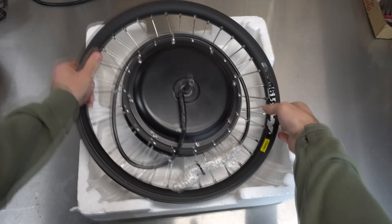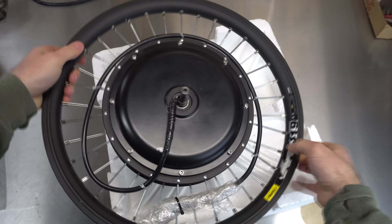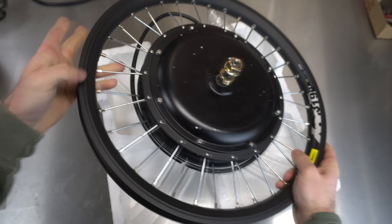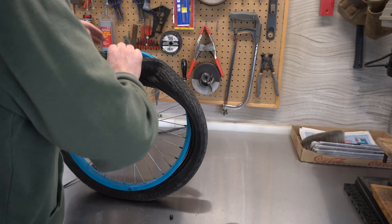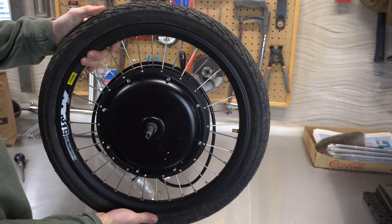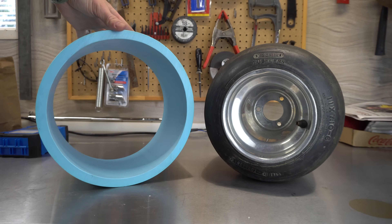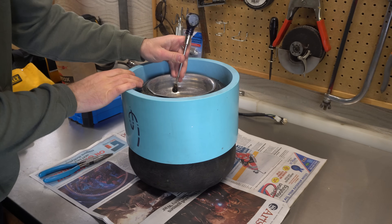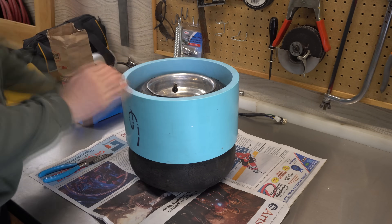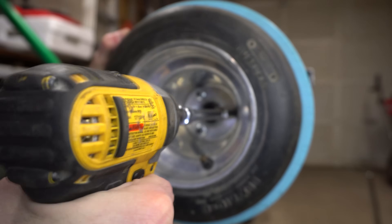The motor I chose for this project is a 20-inch 48-volt 1500-watt front hub motor. The link to this motor as well as all the other parts used in this video will be listed in the video description. I salvaged the tube and tire off of the original BMX rim and installed them onto the new one. I picked up some used go-kart wheels for the back, and because this is a drift trike you don't want the back wheels to have any grip, so you need to buy a couple of these giant PVC sleeves to put over the tires. Surprisingly, these were quite easy to install — I just deflated the tires and pressed them on until they were centered over the wheel, then filled the tires back up.